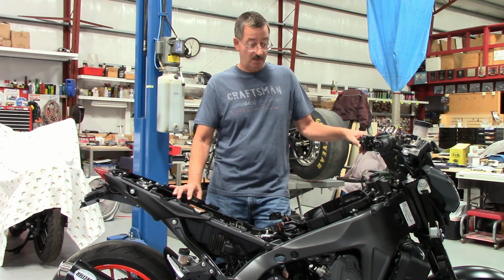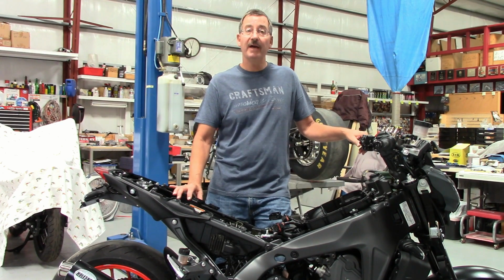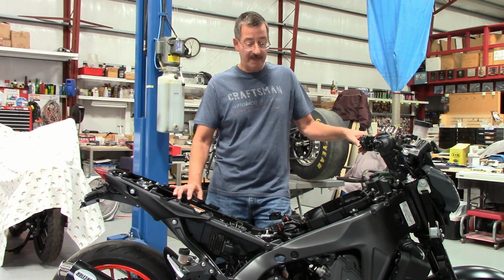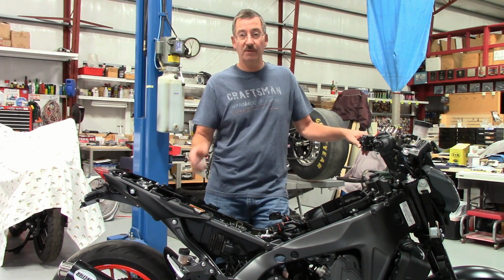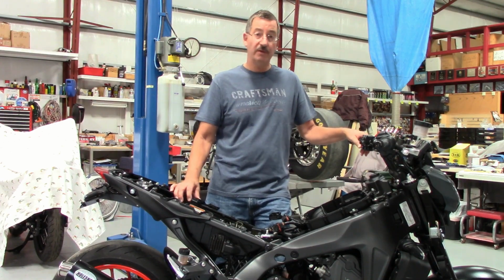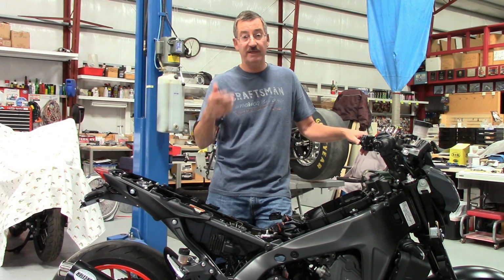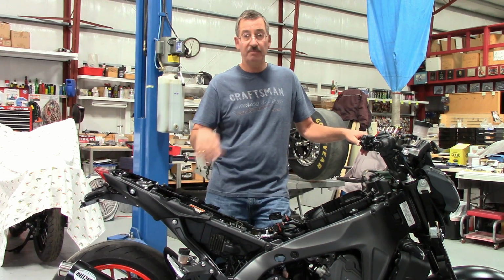So we're going to start with that, and we're going to get it on the dyno, and then I may have to send the ECU back one more time for a touch-up with my input, and show Chris what it's doing. He pulled about 4% fuel out of it for my elevation, just a tiny little bit.